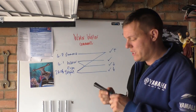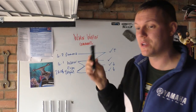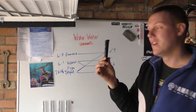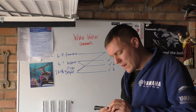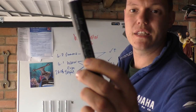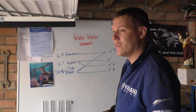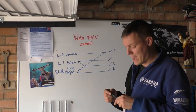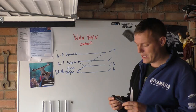They're pretty cheap actually, and they're not brilliant, but basically it's two probes, and I'm going to show you how this works, because we can test this on methanol, acetone, brake fluid. It's for testing brake fluid, and it gives you percentages. It's got a little LED, and all it does is it basically just tests the conductivity of that fluid, as far as I understand. But it's a brake liquid tester.